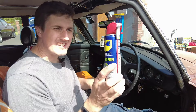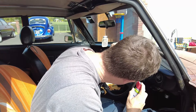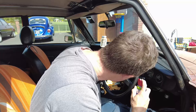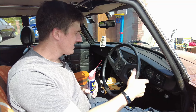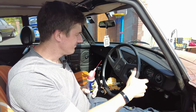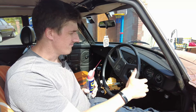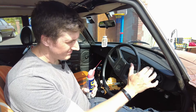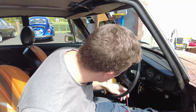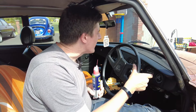This stuff goes a long way — WD-40 contact cleaner. There are other brands available and some of them are better than this, but this is the one I have, so I'm going to spray it in here and just cycle the switch a few times and see how they're working. That problem is fixed and we can also check our full beams — the indicator light is working.